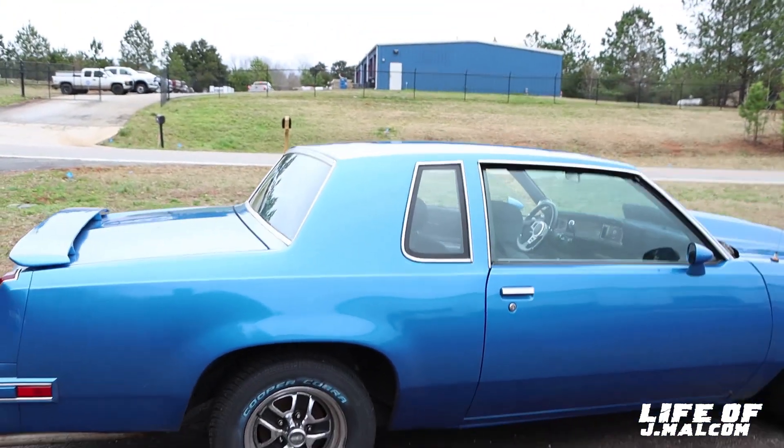I got to go to O'Reilly's — we got all the car springs for both of the G-bodies, for my car and wifey's car. So we got to do that. We're going to head over to Lawless first though. So we're over here at Lawless — they got finished getting the car adjusted. The floats — the float levels were high. So Jesse just hooked that up for me and I appreciate him for that. We should be good to go. He was a fool with the floats and stuff, so I brought it over here and he just showed me how to do it and did it. Both of them were high, so now we're going to get back to the house and we shouldn't have that problem anymore.